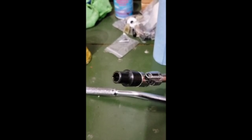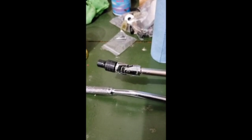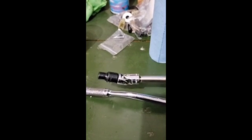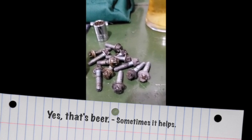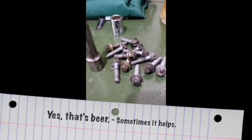And incidentally, to remove the oil pan, you're going to need a Torx bit. It's an E10 and one of those universal joint type adapters. That's essential to get at some of those pan bolts, but they come off pretty easily. They're pretty low torque. Didn't break any of them. Actually, some oil started leaking out of some of these when I took them out, which tells me that the pan is not ridiculously tight, so I can hopefully take it off without too much trouble.